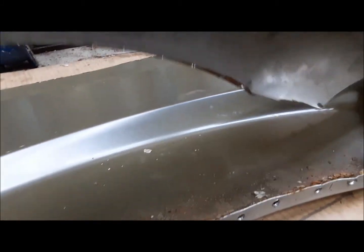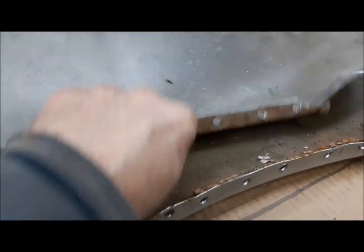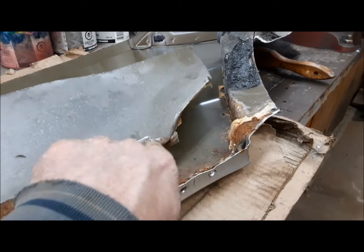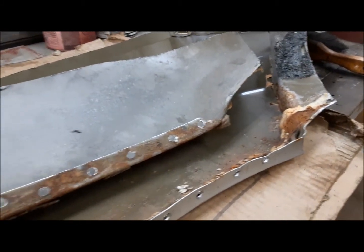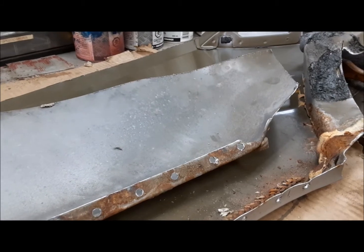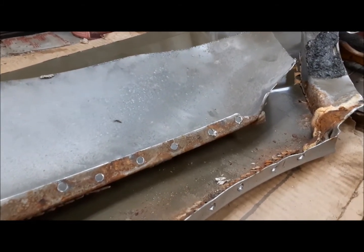It's free. Now in reality we could have taken this apart first and cut a piece out of here to repair our wheelhouse, but then we would have been trying to fill this hole completely with weld because our spots would have lined up. And that's what I was trying to avoid. But if it was a larger area, that may have been a wise decision. But anyway, for what we're doing, I think we did it the right way.